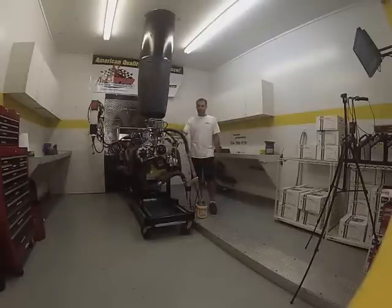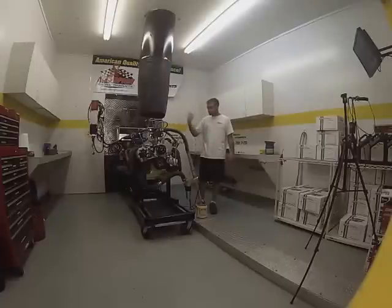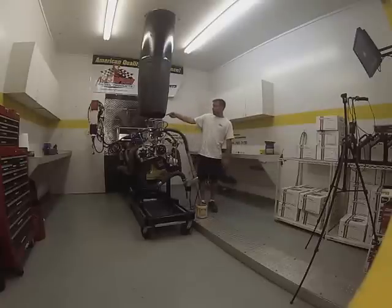So, that's kind of what this is. It almost somewhat falls into the Eliminator type of stuff, other than the fact that it doesn't make ungodly crazy amounts of power, like most of the Eliminator stuff we do is 2300 horsepower. So, we're also utilizing an INGLESE stacked Weber injection, just an as-cast manifold, and then the INGLESE Weber injection system. Running a Holley HP EFI.